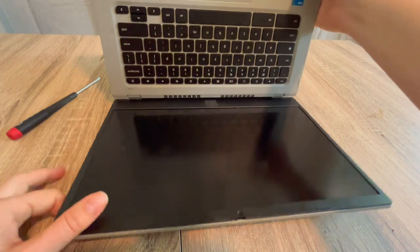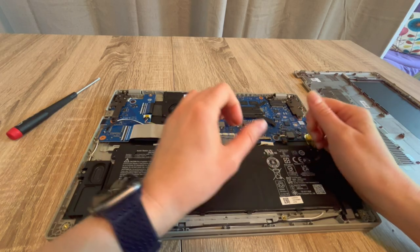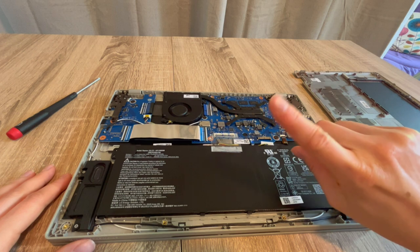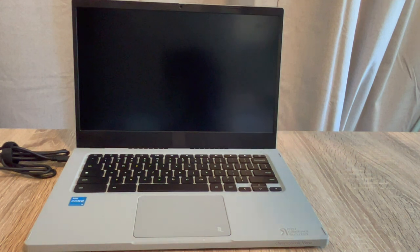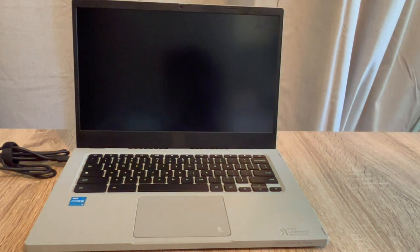For step three, I'm going to unplug my battery again and hold down the power button for 30 seconds to a minute. This time, I'm not going to plug my battery back in — I'm going to plug only my power cord back in and see if that revives the computer. If it turns on, then I know the battery needs to be replaced.